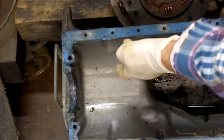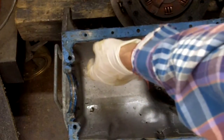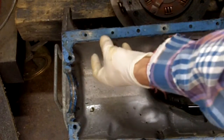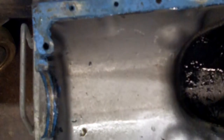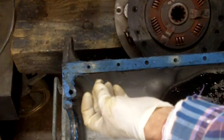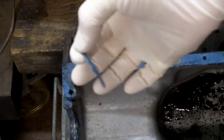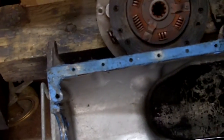Another thing we don't like is the RTV. You have this blue RTV which might be great for a small block Chevy, but it's not very good for these engines. The problem is the RTV squishes out on the outside and on the inside of the engine. The potential for this stuff to break off and get clogged in the oil filter is real — I've dug this out of the camshaft before after they've destroyed engines. So we don't use RTV. Use number two Permatex or Yamabond.